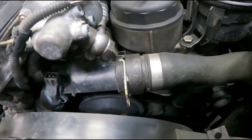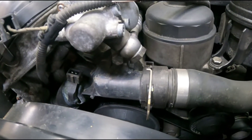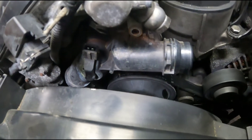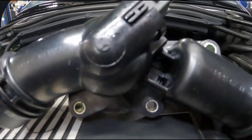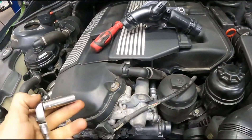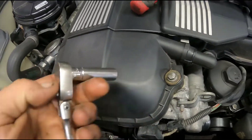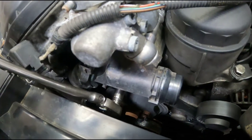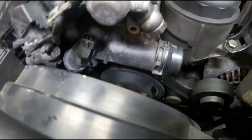I'm going to go ahead and pull both of these hoses and take those upper bolts off. Now that those upper bolts are released and the hoses are off, you have to get to the two lower bolts. Looking at the new one will help you figure out where those are located. Use a 10 millimeter deep socket — I like to use my long quarter inch ratchet with a deep 10 millimeter socket. You can just fit it right in here, get to those, and get them loose. Then the thermostat housing will be ready to come out the top.